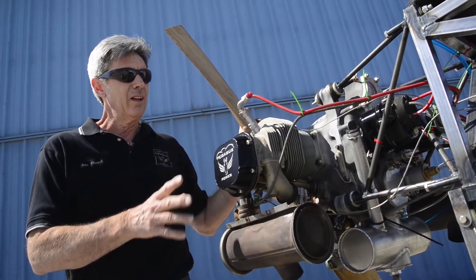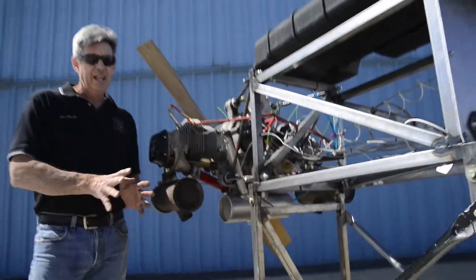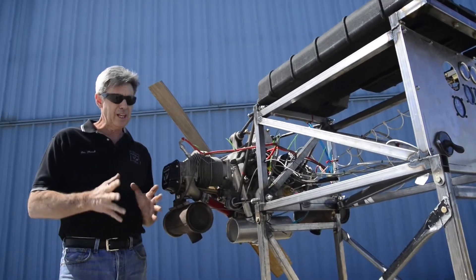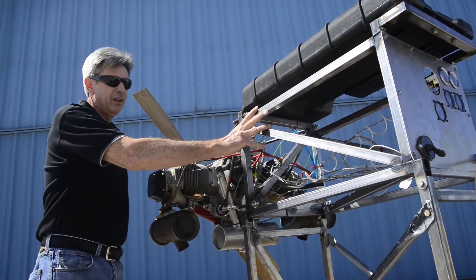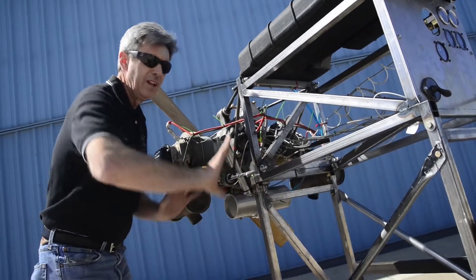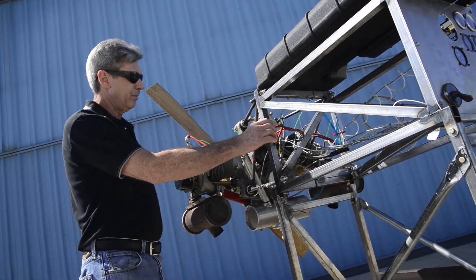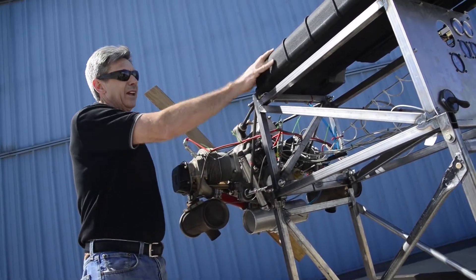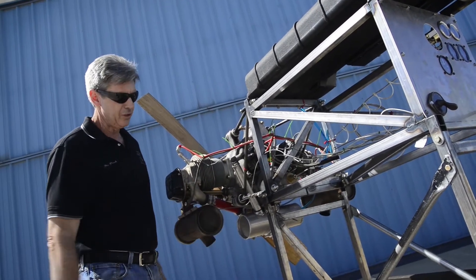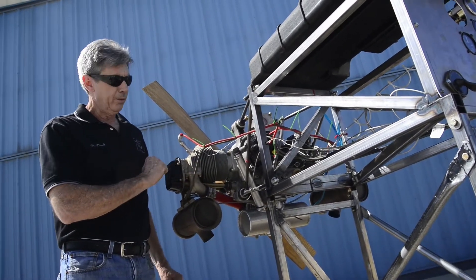What I've got here is a test stand that is mounted to my trailer. I can take this out to shows, move it around — it's very mobile and real stable. I made this out of one-inch square tubing and it's retractable, so I can remove these and fold the whole unit down, bring it back up and pin it. It's got a standard style engine mount and a fuel tank up on top for gravity feed. There's no fuel pump on this particular engine, although you could build yours with a mechanical fuel pump on it.